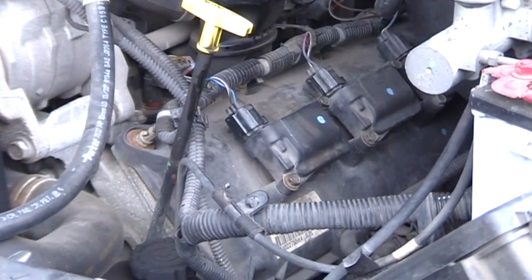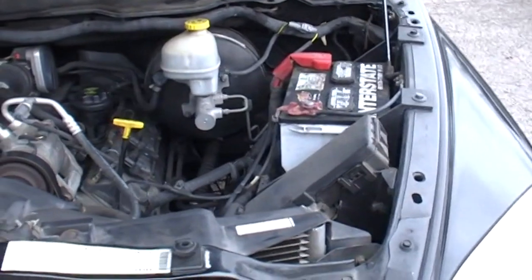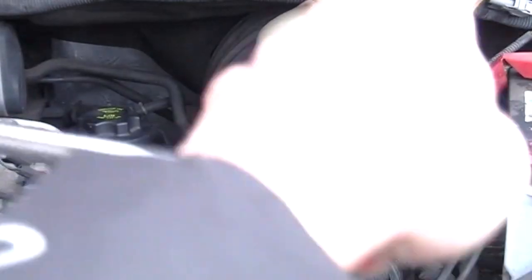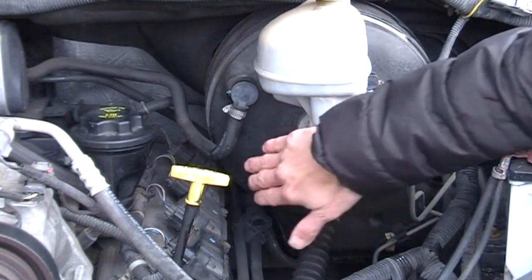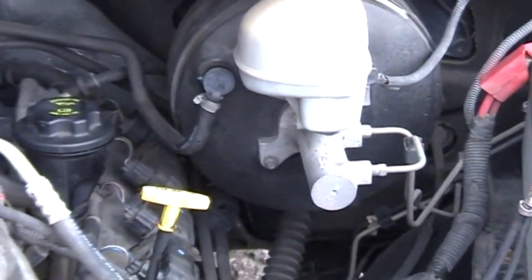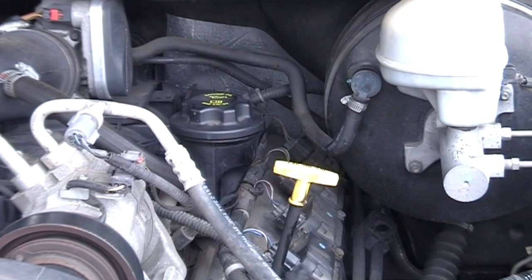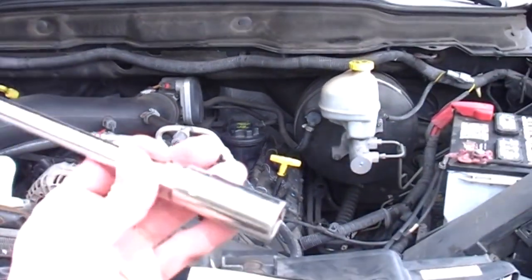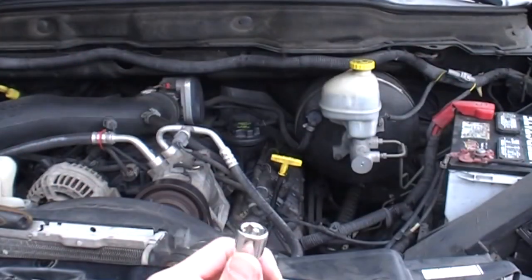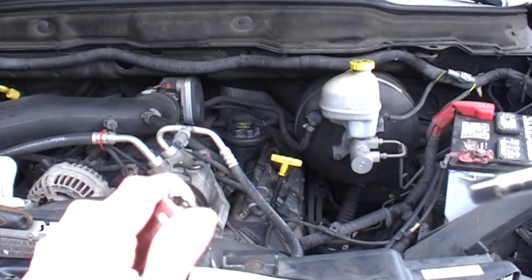One difficult part I want to mention: over here you'll see a black circular component — that's your brake booster. The coil pack in the very back of the engine is going to be a tight one to access. You'll need to insert the spark plug into the socket first with the extension, lower it in, then attach the ratchet. When removing it, take the ratchet off, pull the extension up slightly until you can get your hand in to unplug the connector and pull the coil pack out. Take it slow back there.